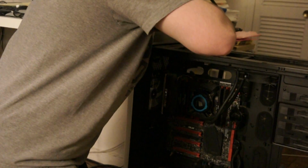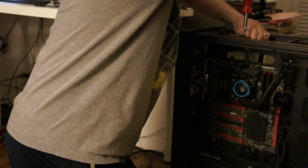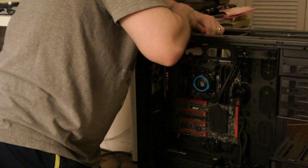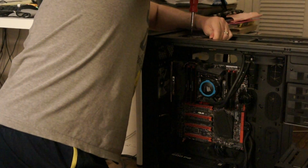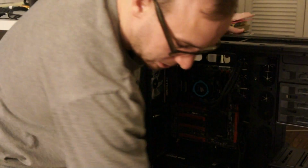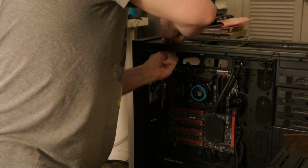It's always harder. Just make sure the fans are in the right direction. I can't tell you how many times I've thought I finished my build and I put the fans in the wrong direction or some annoying thing. Remember, don't tighten them too much yet. Wait till you get the opposite corners in. And that's why I open the back, because I want to run this wire. It's better if it goes through this hole right up here and not through anywhere else. Keep it nice and clean.